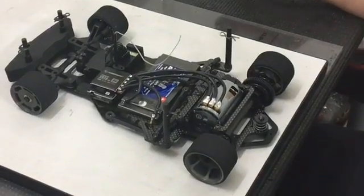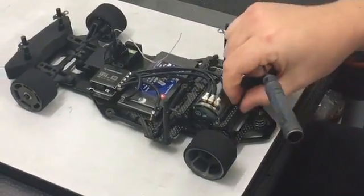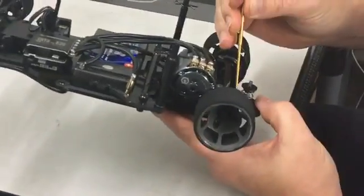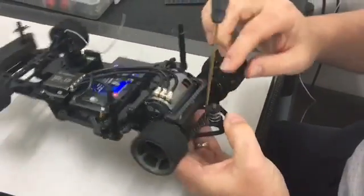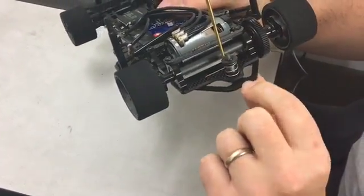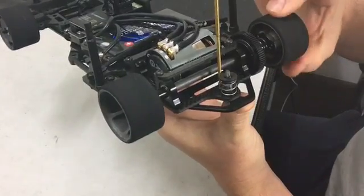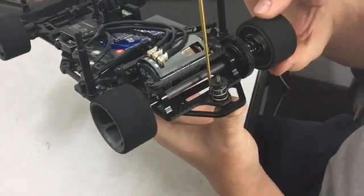In this short clip, I'm going to explain to you how you adjust the rear droop on an RXGT12. The first thing you do, by using the droop screw, which is just in front of the rear spring, is we lower the pod plate down so it's just sitting above the aluminium chassis. You don't want to go too low because you don't want to restrict the movement of the pod. So you want to go as low as you can without restricting that movement there.